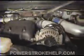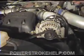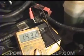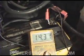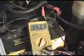This won't work when the batteries are fully charged, because the voltage regulator will not turn on the alternator and you won't get any magnet at the back there. Now we're at 14.3, 14.2, which is pretty strong. The batteries and the alternator are pretty good. Once we've established these things are okay, we can go to the next step.